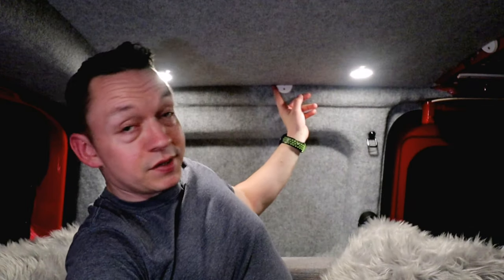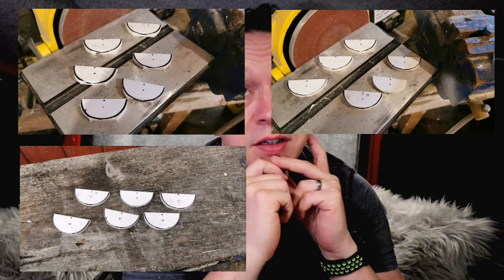I put the roof lining to one side and sat on the idea for a few days thinking about what to do. Then I came up with the idea of making these like pucks — half circles that I made out of plastic. I made them out of some UPVC window trim that I had knocking around. I drew out the half circles, cut them, used a sander to sand them to shape, and then fitted them in. I'm going to carpet over them so you can't really see them — one's actually been carpeted. I've got those in the corners going around and they hold it up absolutely lovely. So now it's nice and secure, doesn't go anywhere. I fitted my lights into it and then carpeted it and fitted it all up. It fits lovely.